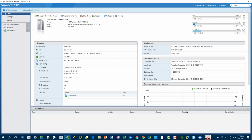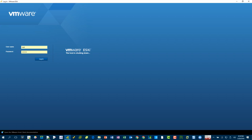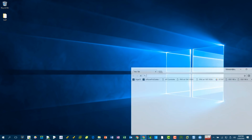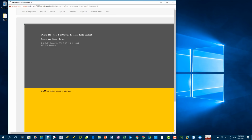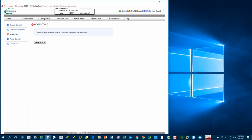All right, so I am ready to shut down. There's no VMs that are critical to me on there, and it's now gracefully shutting down. What this also means is that back on the browser interface, whoa, I went a little too far with the shutdown there. Back in the interface where I was showing you IPMI, there we go. That's the window I was looking for. You're going to see shutting down as ESXi goes down, and now it's halted. Cool. That window's not doing a whole lot anymore. I'll close that and bring up IPMI again.